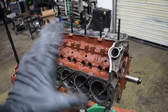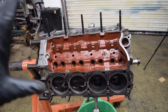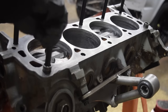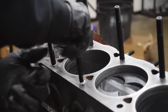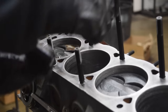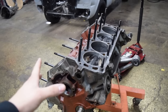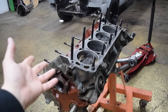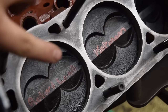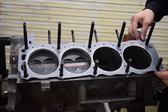With the improved clamping force of the head studs, we in a way take away that engineered failure point, which could be a bad thing. We can still blow a head gasket — it's definitely possible — but if we take away the engineered failure point, the engine will assign a new failure point. I'm not too worried about that because this engine is not pushing much power. Maybe if we were pushing 300 to 400 horsepower, which is pretty much the limits of this block, then I'd be worried. We're installing these so we don't have to keep buying head bolts, and because the cat man and Robert Lugo helped us out with this — now you guys are forever stuck in this block.